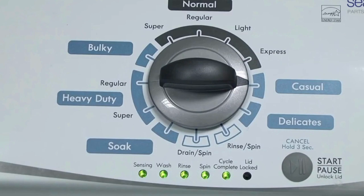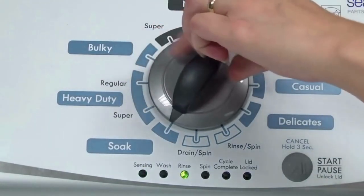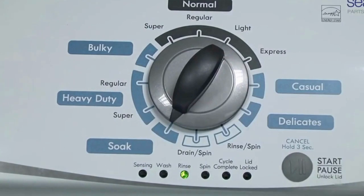All the green status lights blink when you successfully activate the diagnostic mode. If the status lights don't blink, try again — and maybe try turning the knob a little faster or slower. Congratulations, now your washer is in diagnostic mode.